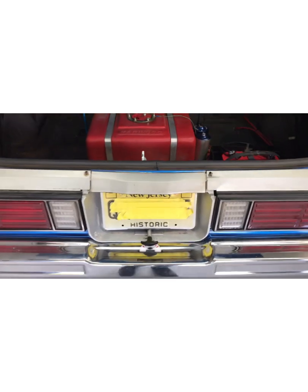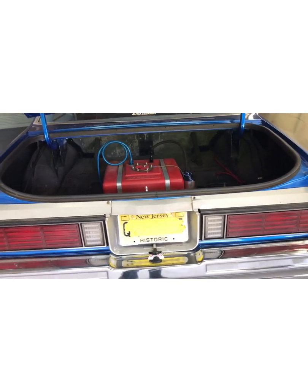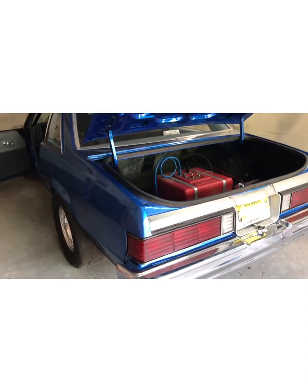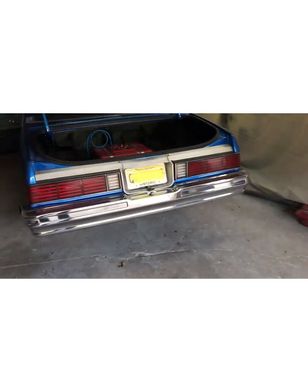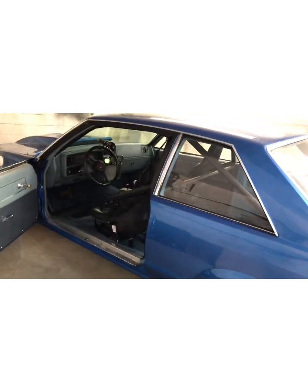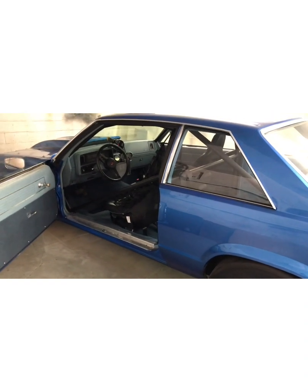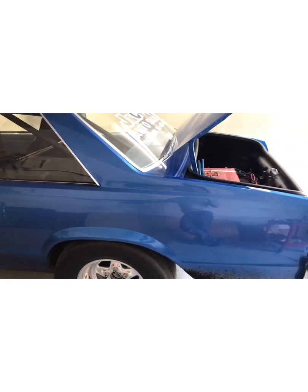And it shuts off. Now this runs an alternator, so very important — if you don't run an alternator, you don't need a four-wire switch. Most cars, fuel injected cars, I would run an alternator on pretty much anything these days. The fuel pumps take a lot and draw a lot of power, so between the fuel pump, your lights, trans brake stuff, you definitely need an alternator.